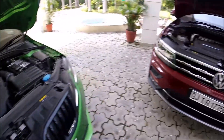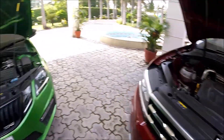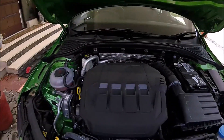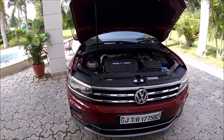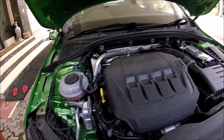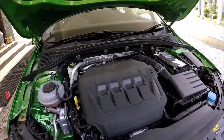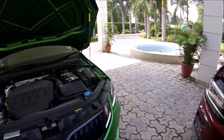The Gen 3a and Gen 3b engines are the two new 2.0 TSI engines currently on the market. The Gen 3a engine on the RS245 is significantly different from the Gen 3b. The 3a is meant primarily for power and is a much lower compression motor, whereas the Gen 3b on the Tiguan is a higher compression engine made for efficiency, with far better efficiency figures.